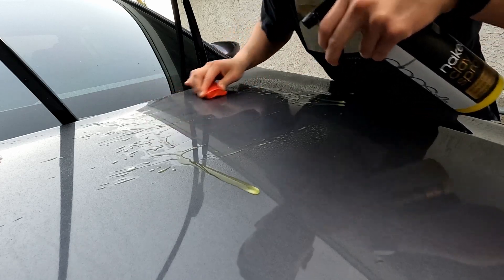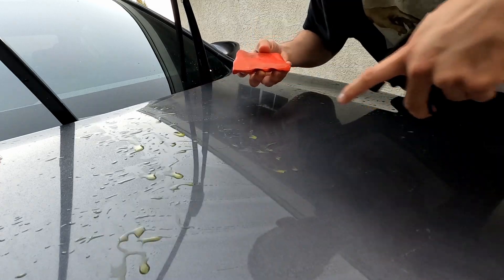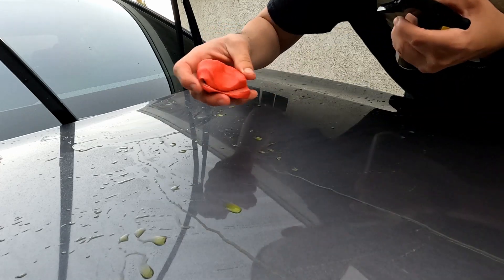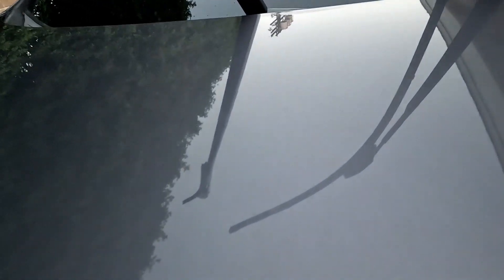You want it so it goes back and forth in a smooth motion. As soon as you feel friction, that's when you start applying it. After the car wash, you can see there's still dirt on the top surface — this is what the clay bar helps with. You want to make sure to rotate the clay bar so that it's not the same dirt getting pushed around. The clay bar and that spray did a really good job.